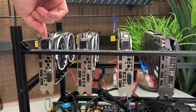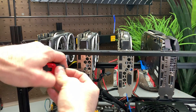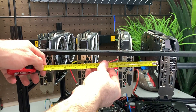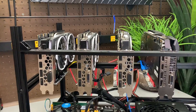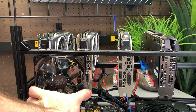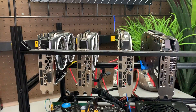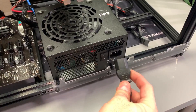Check to make sure you have adequate space between the cards. The cards need to take in cool, fresh air to cool down the heatsink and the GPU. If you'd like to add fans to your rig, consult the frame's guidebook for fan installation. You can also use a box fan or any other desk-type fan that's detached, and just point it where you need cold air.